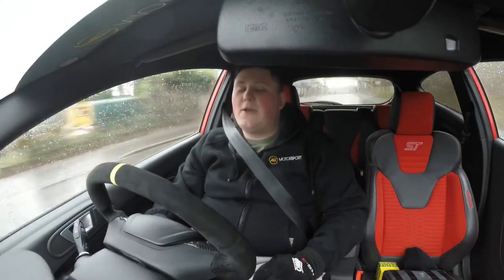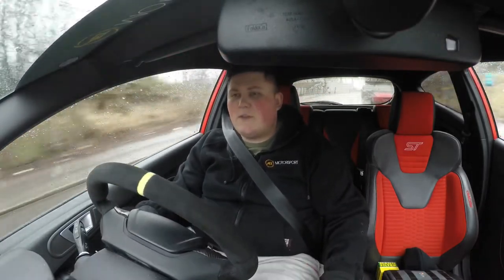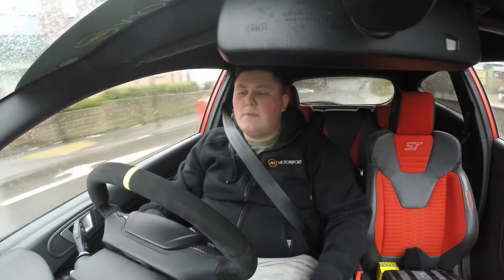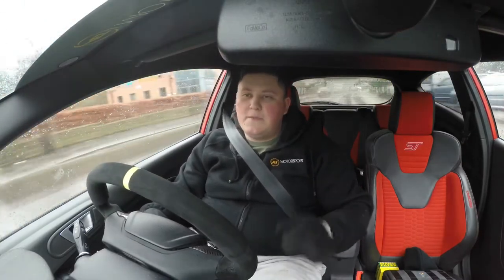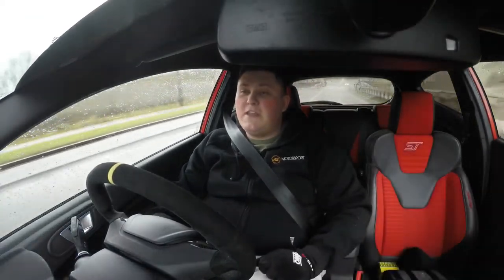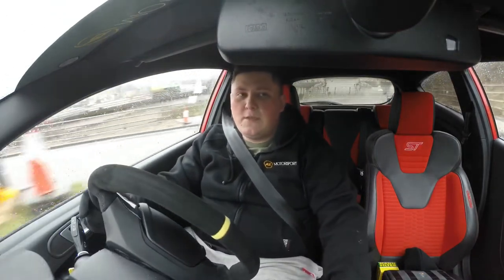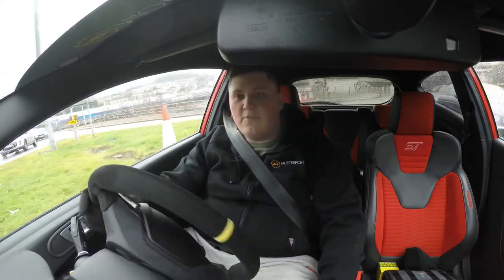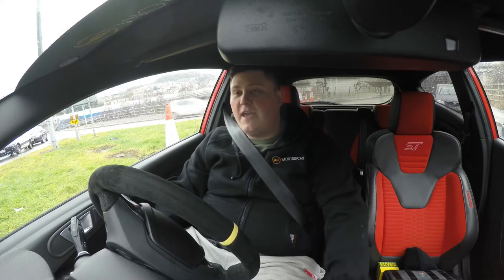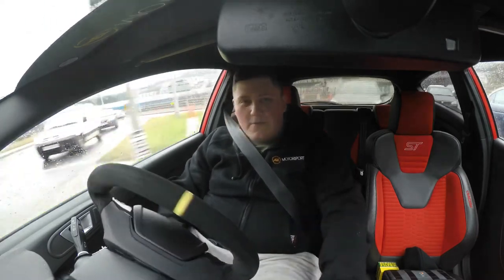But first I want to talk to you about my clutch. My clutch has started slipping — it started slipping about a thousand miles ago maybe. You just used to do it in sixth if you tried putting power down in really low revs. But it's come to the point where it started to slip in each gear, gradually getting worse. So you can't put any power down at all. Being at stage 3 that's pretty useless. I've been in stage 3 for about 20,000 miles and I've given it a lot of hammer on the drag strip and stuff like that. So I've booked in for a new clutch, new flywheel, and I'm also getting a Wavetrac diff. That's a pretty big modification I'm looking forward to — hopefully you'll see some benefits on track.